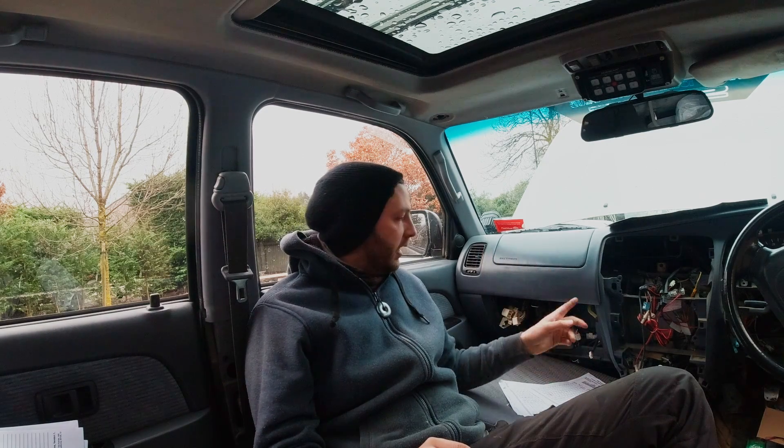It looks like when I pulled everything apart to put the turbo in, I took the starter out because I knew it was on the way out. I didn't really want to buy a new one at the time, so I just cleaned it up and put it back in without testing whether it actually works. I'm thinking it doesn't. I can get power through to the starter and so on — it'll extend but it won't spin. Once we've got a new starter, then we can find out whether this is actually wired in properly or not.